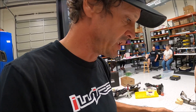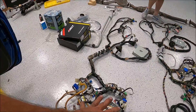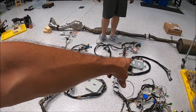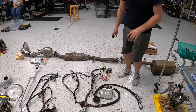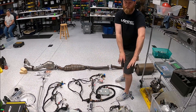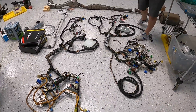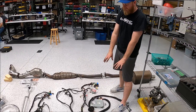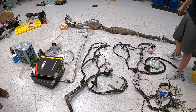Just so you get a grip on what exactly Brian does when he gets a harness — this is the factory harness we just took out. Basically all of this stays the same up to the ECU part, and then after the ECU is where he changes it. Everything over here, which is all the stuff that talks back to the car, is exactly as it was — your dash, headlights, taillights, doors — all that's going to work exactly as it did before. All we did was change the ECU and engine plugs, so you put your new ECU and engine in your old car.